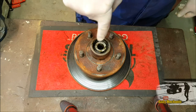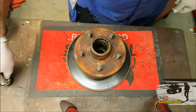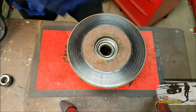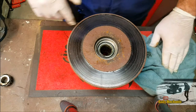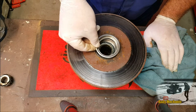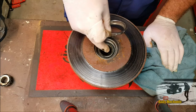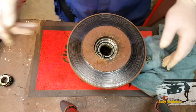The first job is we can remove the inner race of the outer bearing just by doing that. Turn the hub over and try to get the grease off the brake disc as best you can - this is a really messy job so have plenty of rags to hand. The seal saver is just sitting around there. If we pop out the inner race of the rear bearing, that seal saver is going to come out at the same time. So what we're going to do is mount it in the vice.